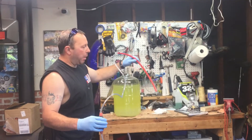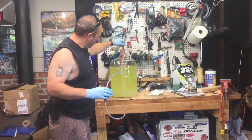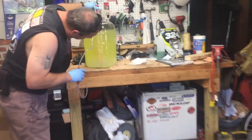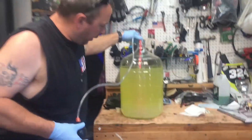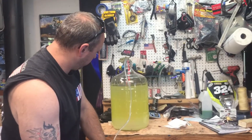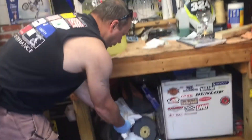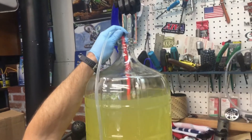Okay, so I'm going to take my primer bulb and my primer hose and I'm going to suck the water and the ethanol out of the bottom of this carboy. So I'm going to stick this in, try to have it go forward to the bottom. You can see it in there — all right, so we're going to prime this, get that out. Got primed good. Now we're just going to start to empty it into my bucket, collecting it right from there. See the delineation line.